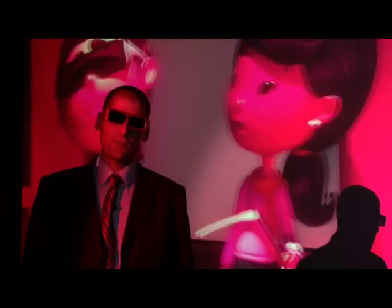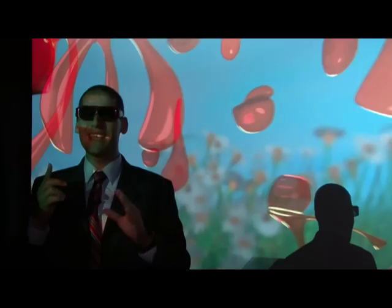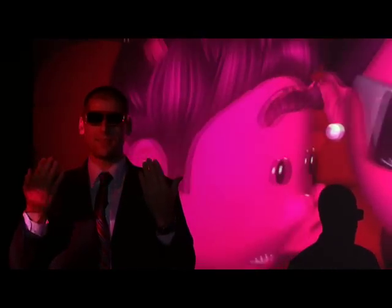The way it works is that the projector up there sends an infrared signal to the screen, and this infrared signal tells the glasses when to open the shutter and when to close it. The quality of 3D is measured by the fact that the right eye does not see any leakage — which others also call ghosting — of the left image into the right image. It's a very simple system: the lens is either completely blocked or completely open.